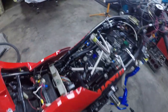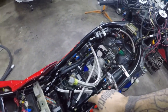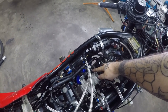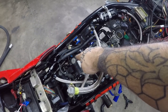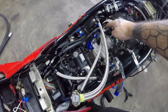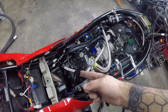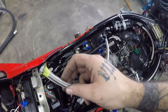complete the fuel system. Fuel in, filter around, pump to the fuel injectors, which is also managed by, you see the hose runs down and under to the fuel pressure regulator, and that will bleed off any excess pressure that I deem necessary all the way up and back to the fuel return, which was the fuel feed. Pretty straightforward, pretty simple. Just need that fitting there.